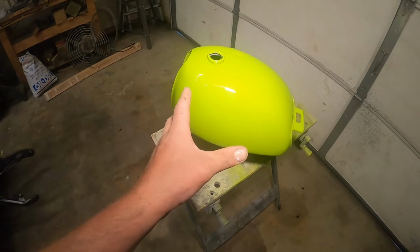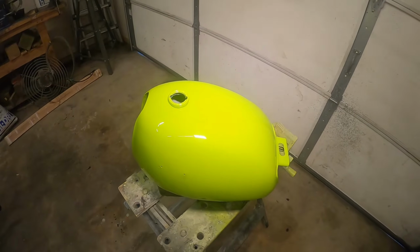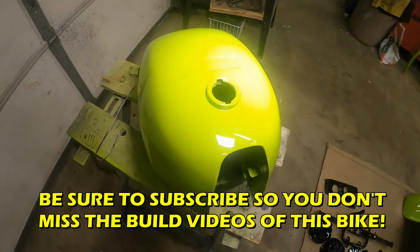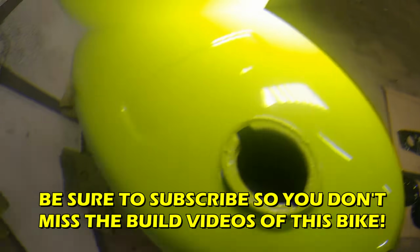It held gas and all that jazz, so I ended up soaking it in Evaporust for a couple weeks and got the interior all cleaned out, and I just put a Por-15 tank liner in there. I don't know if you can see.